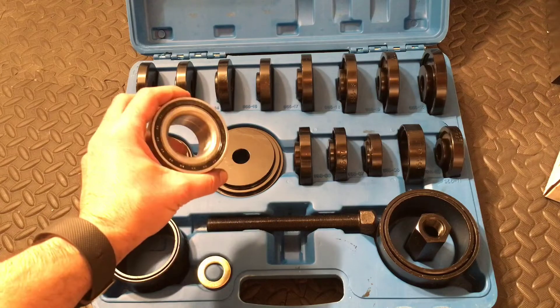You can see the hub going into the knuckle there. Unfortunately I can't get a really good shot, but you're pretty much right near the bearing itself is how far you want to go in, with the hub actually resting on the bearing. So it's crucial that you do it by hand unless you have an actual press, so that way you're not going too far in and hitting it.